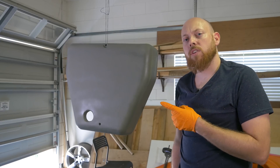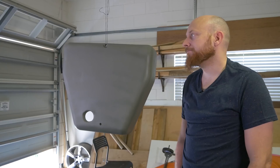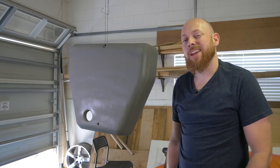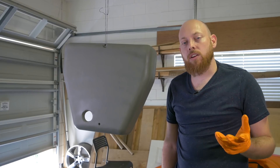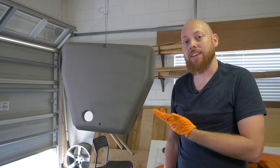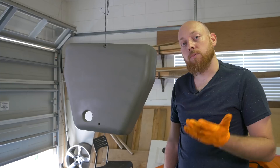While that's drying up, I figured I'd talk a little bit about primer and why you use it. I apologize if this is basic to some of you, and this applies to all kinds of paint, not just spray paint — so if you're painting out of an HVLP gun or something like that, these principles still apply. Top coats and color coats really aren't designed to stick to plastics and metal; they're designed to stick to primer. So stick the primer on first, then the color coat.